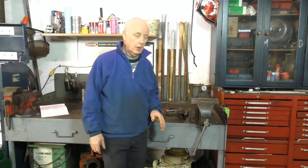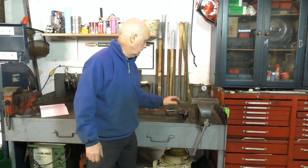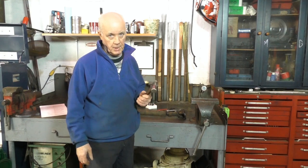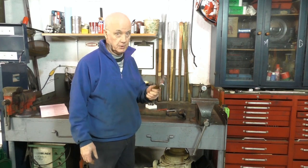What we're going to need for this job is a sturdy vice on a good bench — mine is metal with the vice clamped to it. You need a ball-peen hammer, a two-pounder. Don't use a claw hammer or construction hammer. If the hammer's weight is in ounces it's not heavy enough — it's got to be a two-pounder minimum.